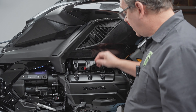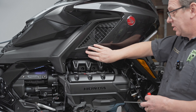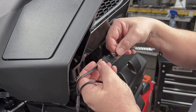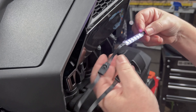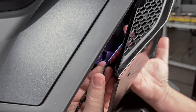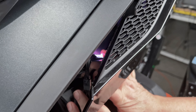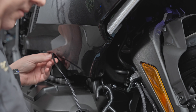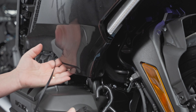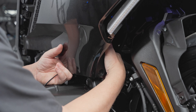So we're going to get this little light up inside of here, just like on the other side. You've got a screw here and a screw here, then pop that panel out. You're going to want to loosen it up — there's a screw here and one of those little push pins here, and one more push pin in here. Plug that light in there. Inside of here we're going to use this light, and there's a ledge right there — see this ledge where my finger is? That's where it's going to sit. Get it situated, just like that on that ledge, then wipe it off and install it. Coming off the lead from inside the engine, you should have the lead come out right here for the front side. Attach a 20-inch extension here and feed it in behind, on top of — there's a radiator hose right here, you want to go on top of that. It feeds through pretty easily.